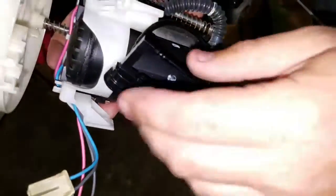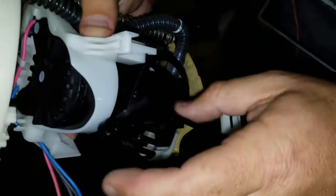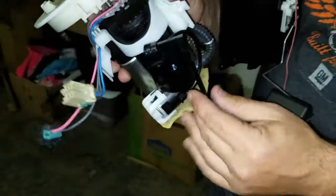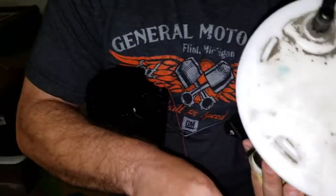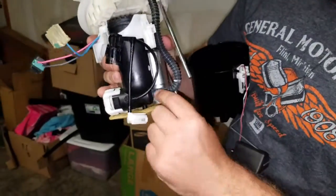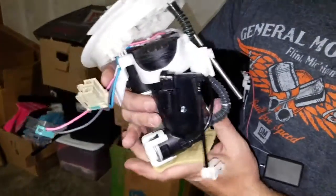Now, thing to note: if you didn't take this off, notice how this hose is bent. When you pull it out, it's going to want to kink and bend and put pressure on it — you're going to risk breaking it. If for whatever reason you do that, this joint here — not the bottom one but this one — will spin. So you can grab each one with both hands and make that spin to kind of angle it. But I prefer the first method — that way you don't break anything. No matter what anybody tells you, don't break this hose. It's not replaceable, it's not repairable. Notice the sharp bend at the bottom. If you get any kind of rubber hose, once it comes off it's a straight 90 because this is the edge of the bucket and it'll kink right here. There's a plastic wall up there, so if it's not a thin piece of rubber — which you don't want — it won't even fit up in there, so don't even attempt it.